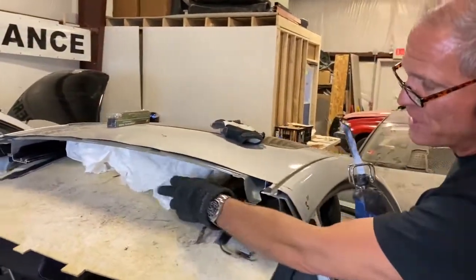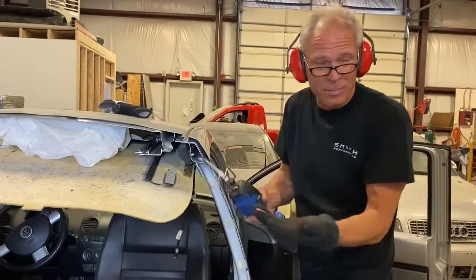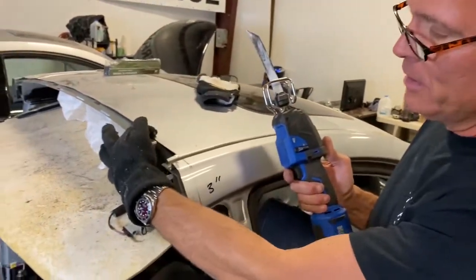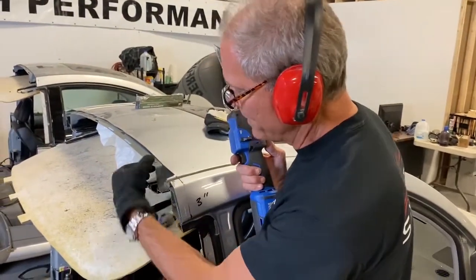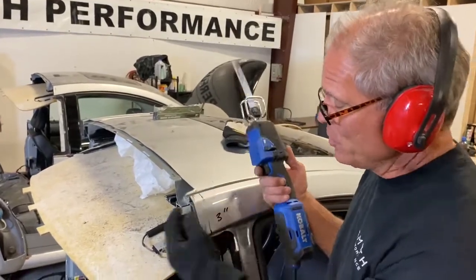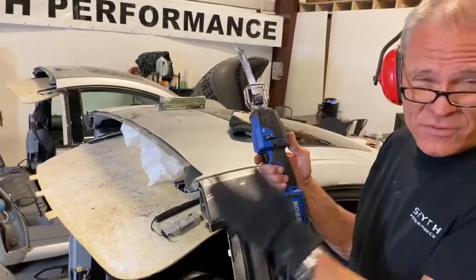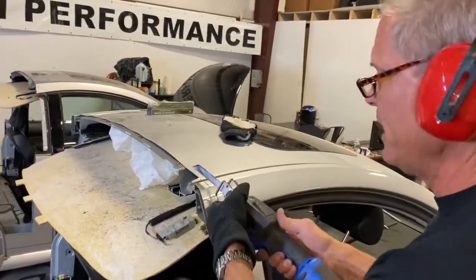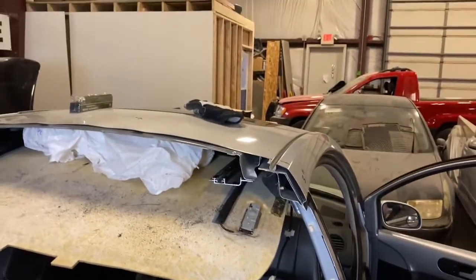So the last cut — we did the skin here and put a little piece of foam in here, just like we talked about at the very beginning, to keep the headliner down low so we don't hit it with the saw blade. This outside corner — remember we marked off the final cut earlier, this little line right here. I'm going to be cutting off just this outer section and leaving the sunroof and this intersection sticking out about three-quarters of an inch beyond the roof skin. That'll give you a little area to anchor the sunroof and another three-quarters of an inch of sunroof travel when you go to finish the car.